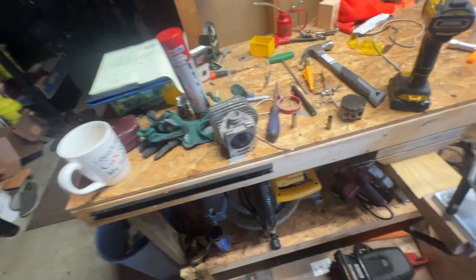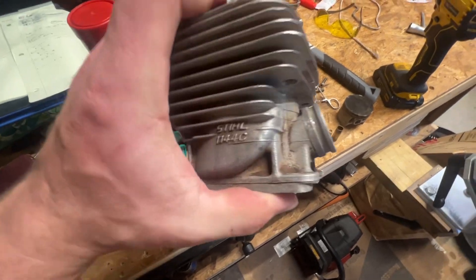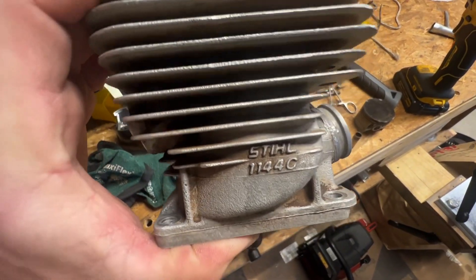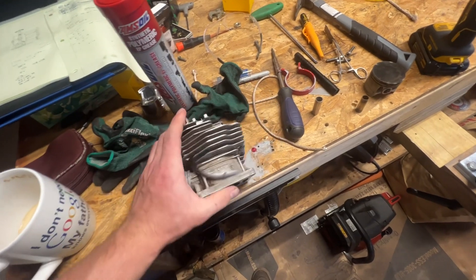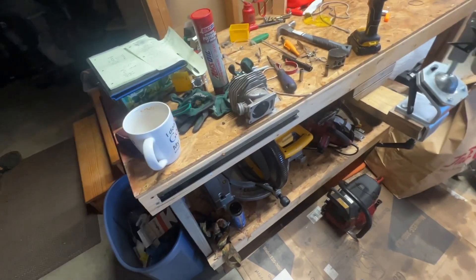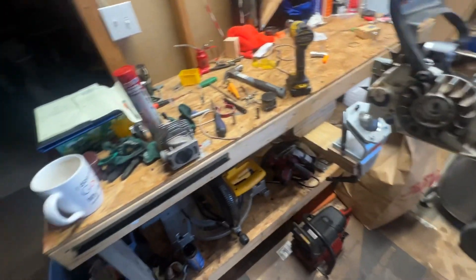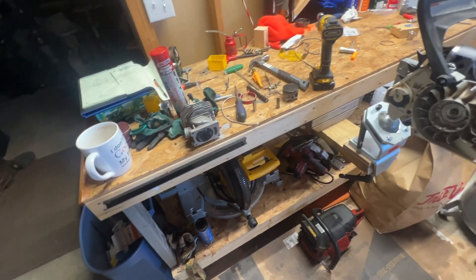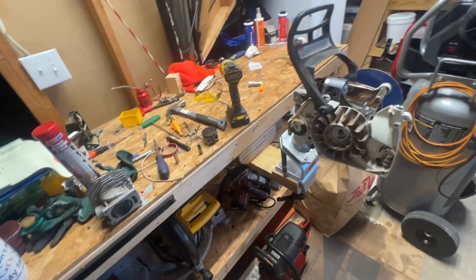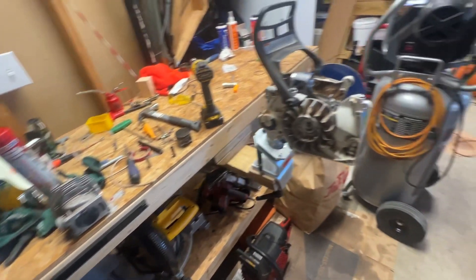If you're porting a 661, be very careful raising those primary transfers. You can see from the outside there's really not a lot of material on that primary transfer side. Secondary — you're completely fine, but the primary side is very limited as far as raising them. You've got to be real careful, otherwise you end up having to do something like this. Hopefully this will last long enough for me to see it all runs good, and then maybe get a new cylinder and try the whole thing again — take a little less off the base and try not to grind through.